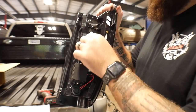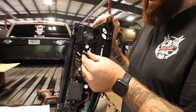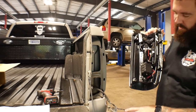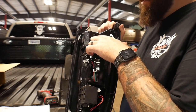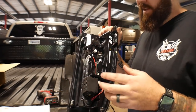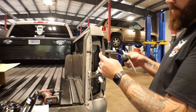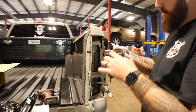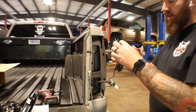Each of your lights here — the inputs are going to plug into the existing light bulb areas inside your sockets. You're going to reuse your little marker lamp bulb and your tiny little reverse light bulb, and I would recommend you get an LED one also. Before you even move on, make sure you put dielectric grease in there — just fill them things full, because even though these are kind of in your fenders, that does not mean it is weather sealed.